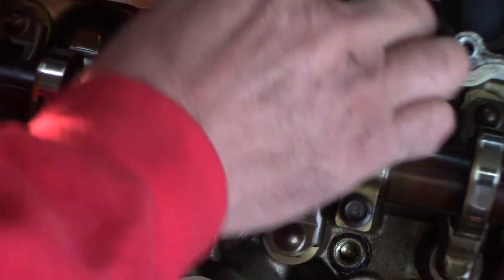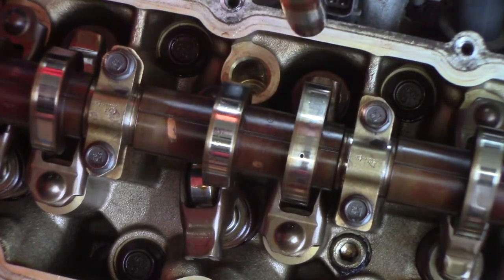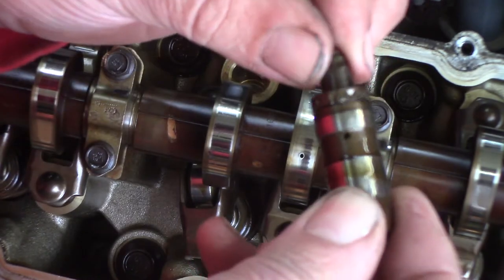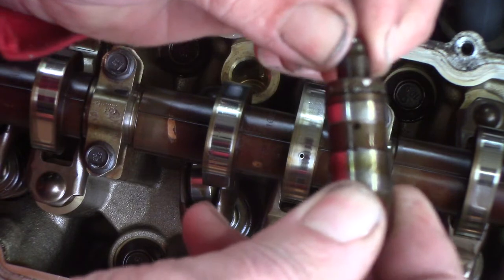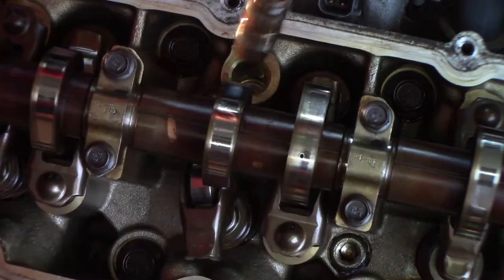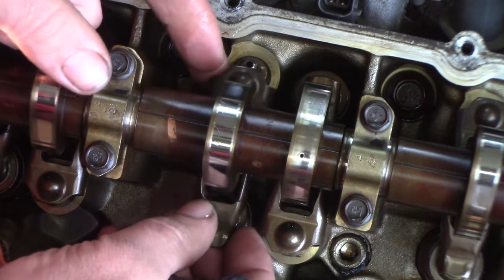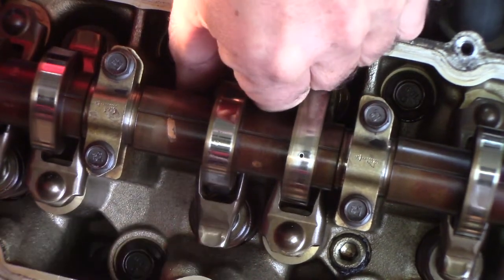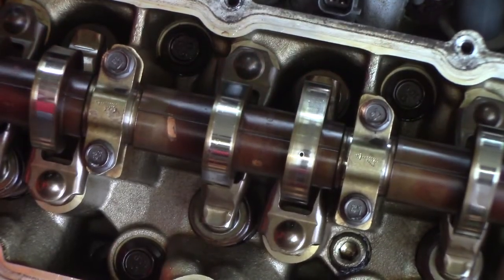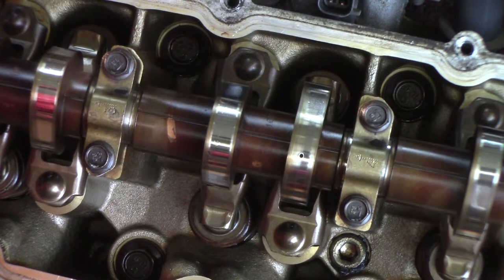I haven't been yanking all of them - I've just been pushing up and down on a bunch of them to see if there's any slop. The slop will be up in here where the plunger goes down - they have a cup and a spring and they hydraulically pump up. A bad one will have slop in it. This one has no slop - I'm tugging on it as hard as I can and there's just no movement. So far every one has been like that. I pop it back in and check it off my list so I don't lose my place.